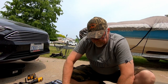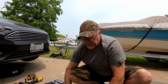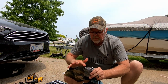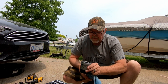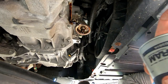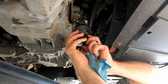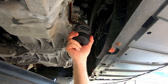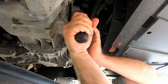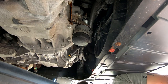Here's where I'll give Ford just a little bit of credit — this oil filter is straight up and down, not on an angle, which makes it a lot easier because you want to fill your oil filter before you put it on. You also want to make sure that you oil the seal. That way you get good adhesion, good sticking — it stays in place. Get this back in place here. A quarter turn. That is it. Now we've got to put the cover back on and we're done under the car.